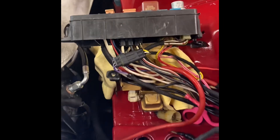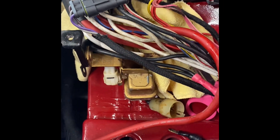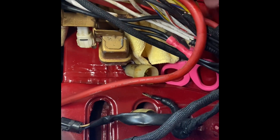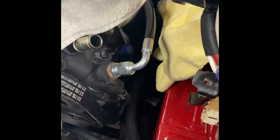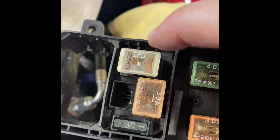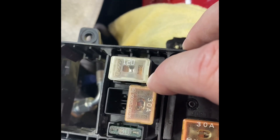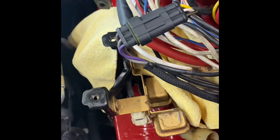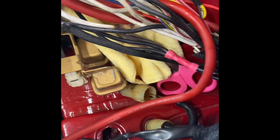We're here to try to get this thing wired up, and I keep finding more and more things that I'm missing in the factory harness. I've got this fuse box pulled apart in the front. I'm going to try to keep it as factory-like as I can. I've upgraded the primary wires coming from the alternator and going to the battery. I've also upgraded the factory fusible link that came in the 86.5 to a 120-amp fuse, because I plan on upgrading the alternator and having a little more current flow than the factory. With upgraded wires we can do that without any risk.